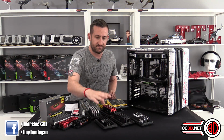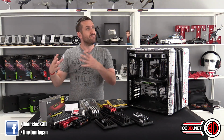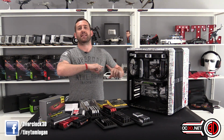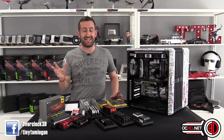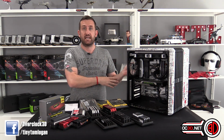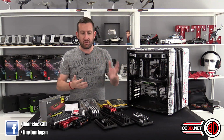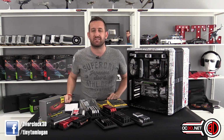And anyway, we do our stock runs like that, and with a stock run, if the results aren't that great, it's normally a BIOS thing. Then what I do is, this is where having lots of stuff around helps, because anything that I'm allowed to keep, I keep, so that when it comes to issues like this, I can really go to town. When it came to 3000 megahertz memory, I worked my way up, and then we'll go to 3200.